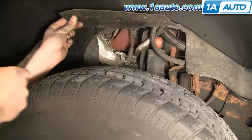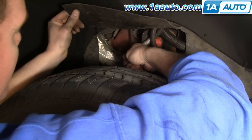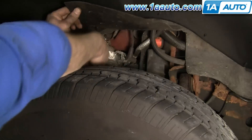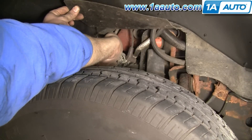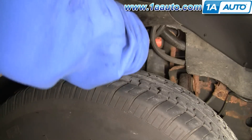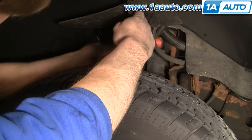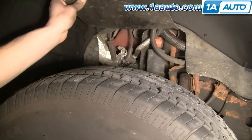Back over at the passenger side — the rear passenger side has a straight-in boot. I'm going to reach in there and grab it with the pliers. Just get a good hold of it with a pair of needle nose pliers, and then you again want to twist it as much as you can and pull at the same time. And you can see there's the straight plug wire. So that rear one on the passenger side and the front one on the driver's side are like that.